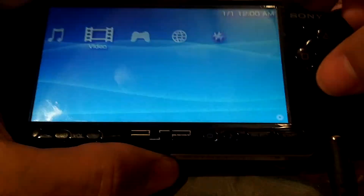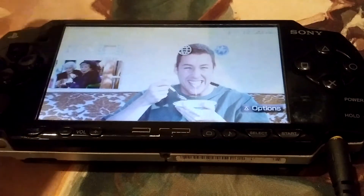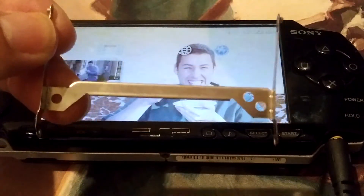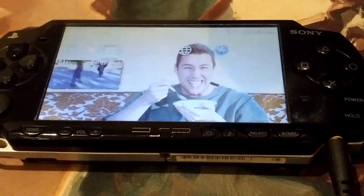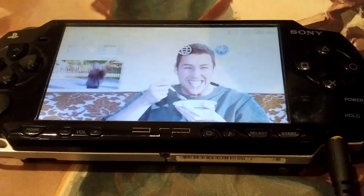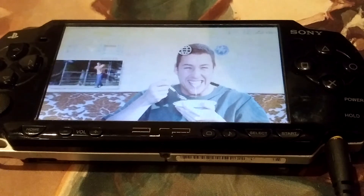So that's it guys, that's how you stop the PSP from shorting out — just remove this little cage here. Adam Sandler, Big Daddy — cool movie. Just remove this thing out of the way, and if you're having the same issue where it turns on and turns back off when you close the door, that's how to fix it. Appreciate you guys watching, please subscribe to the channel and we'll catch you in the next one.